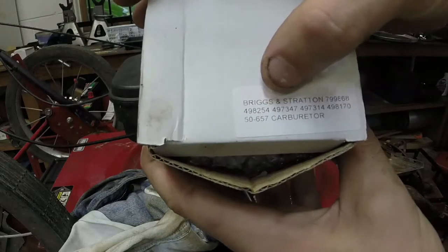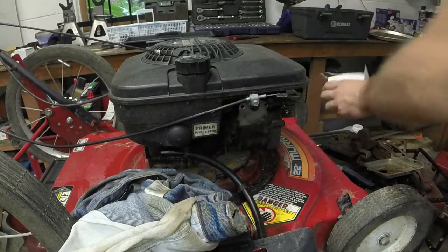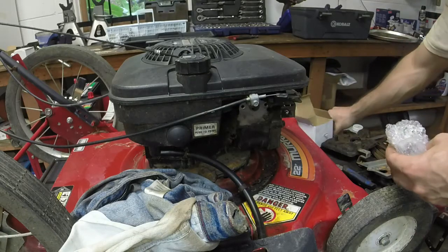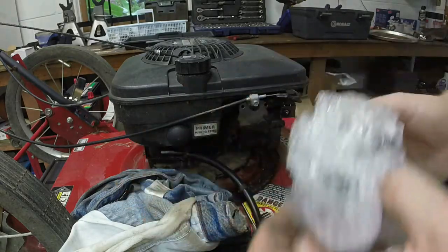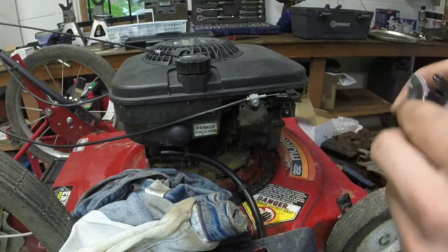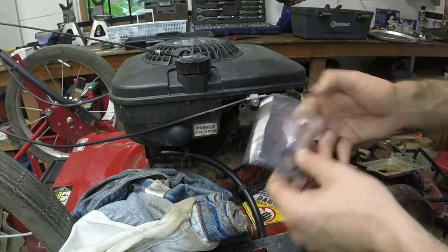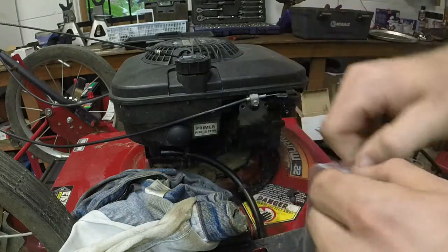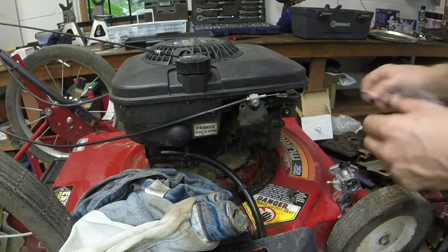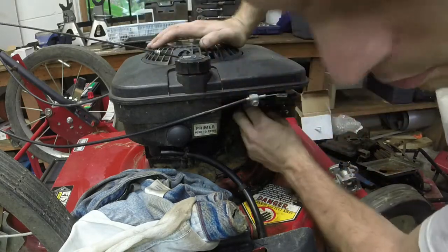I'm going to take off the oil o-ring because I've got one with the new carb kit. We'll put this new carburetor on — it's just the typical 7998-68. Here are all your other numbers if you're interested — basically all the same carburetor. There are supposed to be some shoulder bolts that go with this to bolt it in, since I have a little bit of a shoulder instead of just threads. The carburetors come with a little external kit — we're going to put this o-ring on, then the gasket goes to the backing plate for the air filter. I'm going to double that gasket up to ensure good priming action.